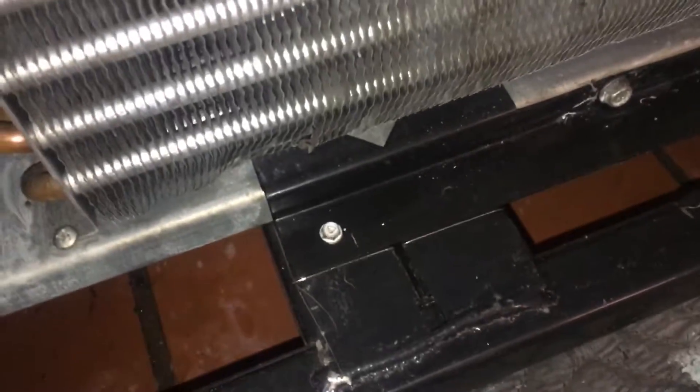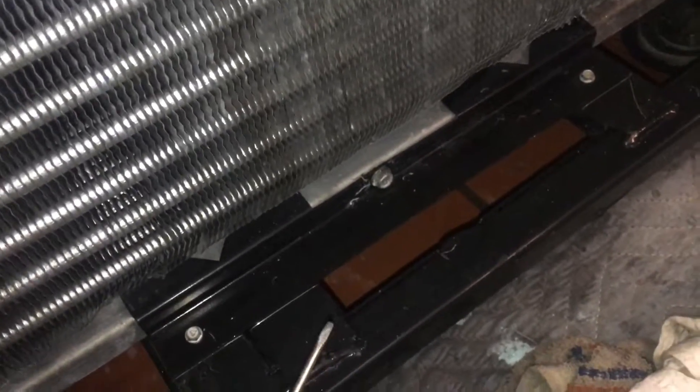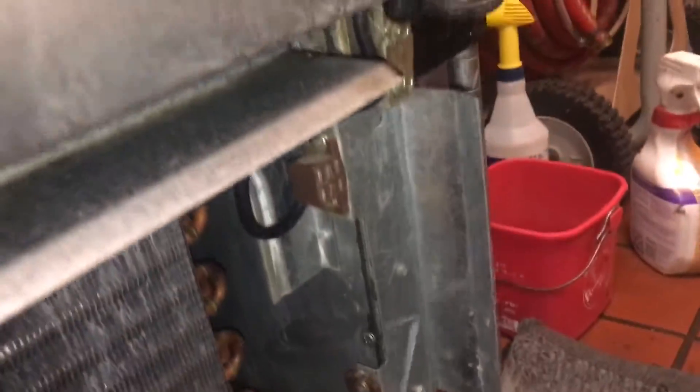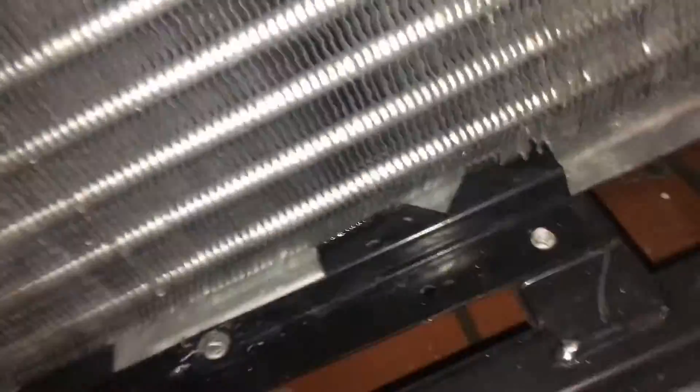Little tip of the day: you see the scratch mark in front of the paint right here? I take a small screwdriver — you can use a scratch awl — and scratch them like that. You want to scratch them in front whenever you take something out and move it. Same with this framework structure here that you've got to take off to get the unit out. So you can line them up — I put a scratch on the back side of this hinge, so you can tell where it lines up again. It helps you when you're reassembling stuff, the height and all that kind of stuff. Just a little tip of the day.